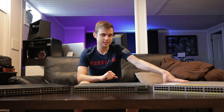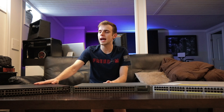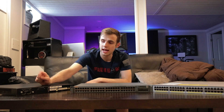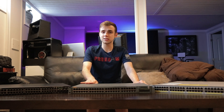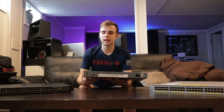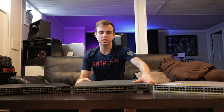The Cisco switch is back-to-front airflow. It takes in air from the back and blows it out the front — it's designed to be a back-of-rack switch. You can pick up this switch in a configuration that has PoE on all the ports. On the back you have stacking ports and an optional add-in slot where you could add 10 gig RJ45 or 10 gig SFP+. I don't have any of those cards — I was tempted to pick one up for this video, but I probably won't use this switch after this video, so I didn't want to spend money on something I'd only use once.